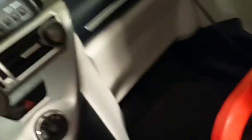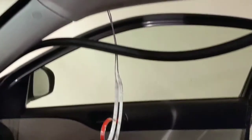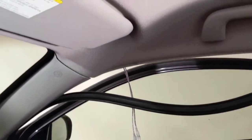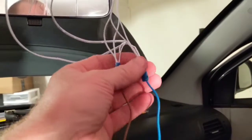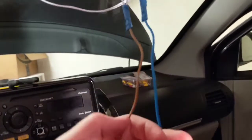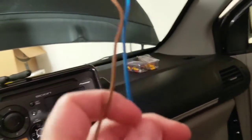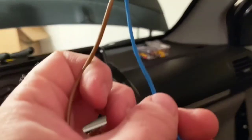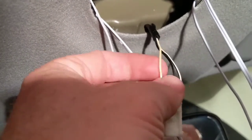I'm going to run these four real quick because I'm going to put them all in generally the same area. I got the LEDs and wiring run — two on that side, two on this side — all of them fished down to the middle here. What I did is splice all four lights together, because I didn't want to mess with the little bit of wire I have to work with right here. I opted to connect them to a single wire, so it's just easier to work with. Then I'll just connect these two wires to my white and black cables right here.